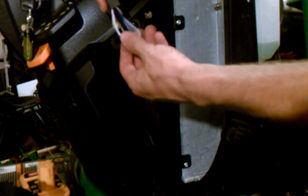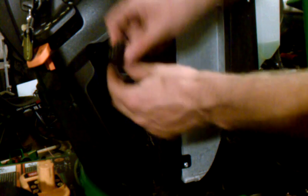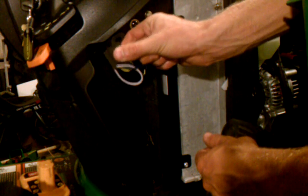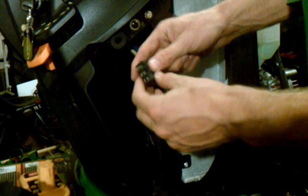We're going to get back in here where the switch is on the back of the dash. You can see I've already jumped mine. The jumper is the white cable that we're looking to put in. It's the two prongs on the back, lower end, reverse side of the tractor that just need to be connected together. Pretty simple task.